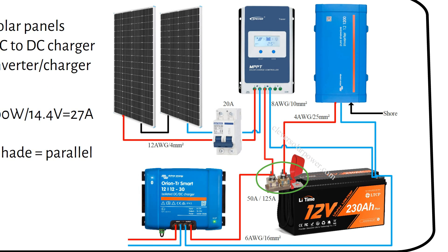The DC to DC battery charger is connected to the starter battery. The cables need to be thicker than normal because of the distance from the engine compartment into the van. That's why I recommend placing your electrical system as close to the engine as possible, ideally behind the driver's seat. The alternator charges your starter battery, and this device takes that power to recharge the household battery. If you use a lithium battery, you should not connect the starter battery straight to the household battery, because lithium batteries have low internal resistance and the charging current will be uncontrollably high. That's why we need a DC to DC charger to regulate the current.